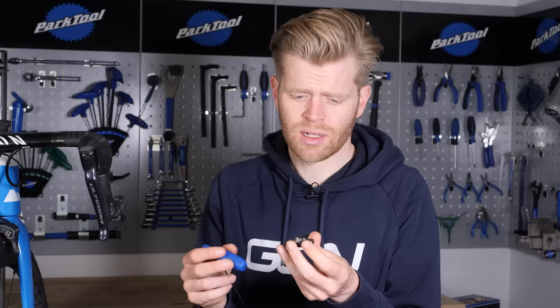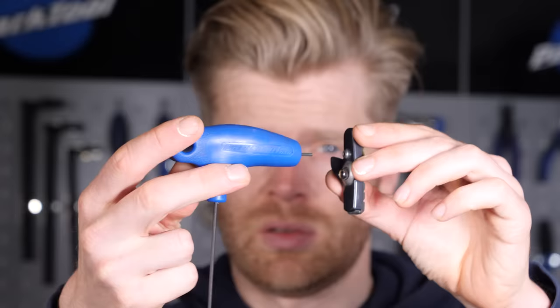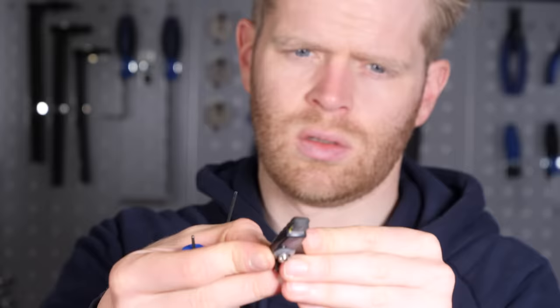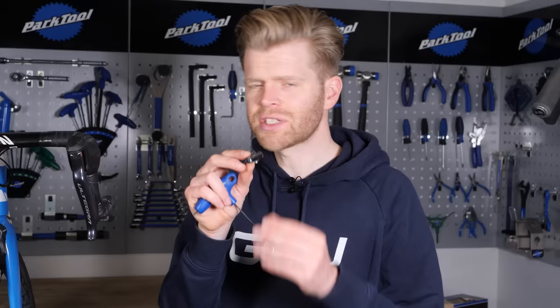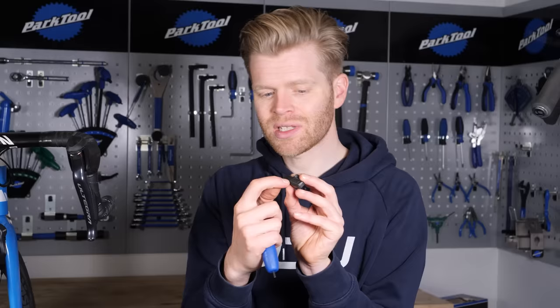When using the little grub screw, make sure you use the correct end of an Allen key — this end and not this end. I've seen many people round out these little grub screws. It's very easy to do, so you have to use the correct end and they don't need much force. They only need to be nipped up as far as they'll go — you don't need to add any extra torque. If Manon continues to use these brake pads, what will eventually happen is you'll wear all the way down until metal starts to protrude through where the brake pad was, and then this will gouge your wheel rims and trash them very quickly. It also makes a horrific sound, so make sure you don't get to that point.